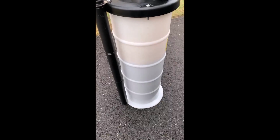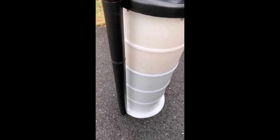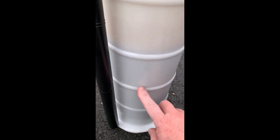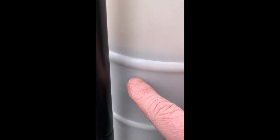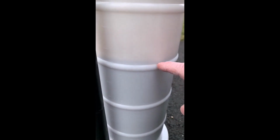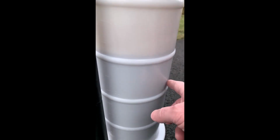Okay, just a quick update here. I made a little mistake in the previous video. I thought that we were only at 3 quarts extracted before I cut out, but it's actually the 4-liter mark is right here. Kind of tough to see. That's the 4.5-liter mark right there. So we're just a little bit below 4.5. This vehicle takes about 4.5. So it looks like I've gotten all of the oil out, pretty much the vast majority of it with the extractor.